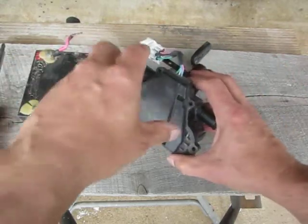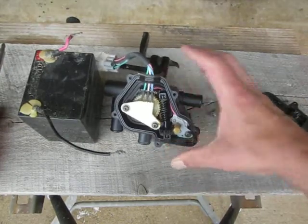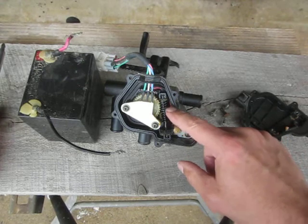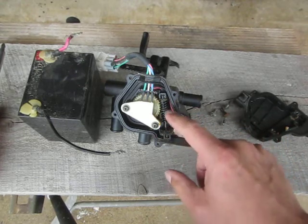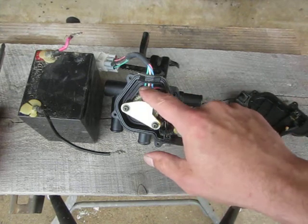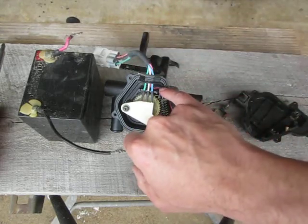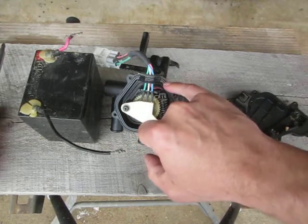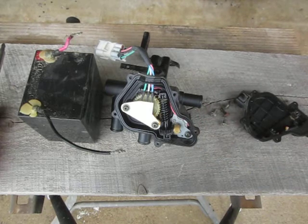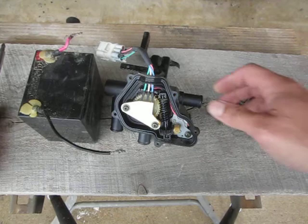Discard screwdriver. Okay, that's what's inside. So we have a drive motor over here, and then we have a spur and worm gear, and then another spur gear. This must be the position sensor, so it might not read position. And there's a black and a pink wire, or black and red, I guess it is pink here, that power this motor down here in the lower corner. Let me see if I can zoom in a little bit. Nope, it won't zoom in this condition.